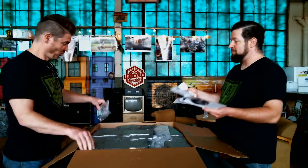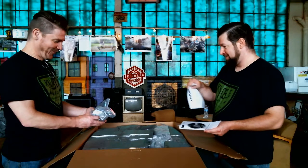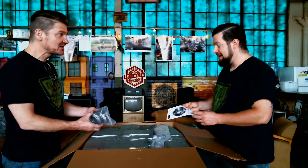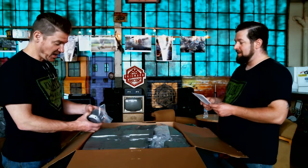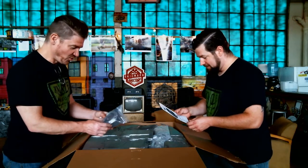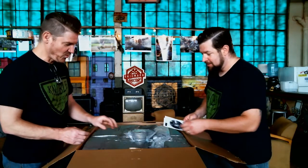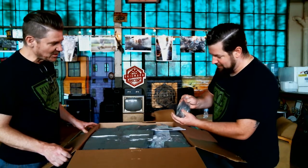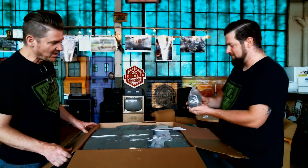You can tune it to however you want, and as you upgrade your bike you can add discs. And there they are — holy shit, that's a lot of discs. They give you a lot of options. You can go down to 12 or 13 all the way up to — that's probably an 18 or 20 disc stack there. They got little gaps in between them. They make cool stuff. Got one on another bike — makes real good horsepower. Nice flat torque band.